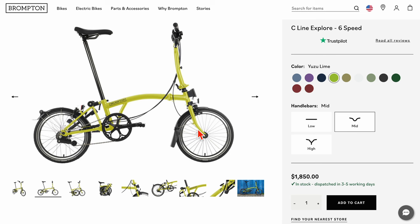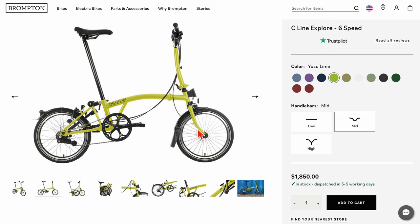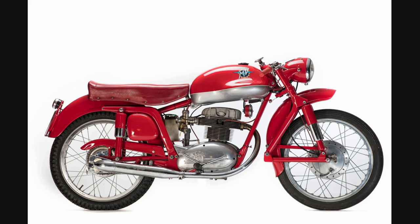If you look at a Brompton and hit a 5-inch deep pothole, the whole front is going to dive into that 5-inch deep pothole. With a normal spring connected directly to the frame, you get a shock absorber going up and down, but the front still has to go down 5 inches. The Italian engineers had the idea of suspending the front here — not at the top — putting the support where the front of the motorcycle connects to the wheel. You hit a 5-inch pothole and the wheel goes up, but it moves at an angle, so a 5-inch pothole might feel like a 1-inch hole.